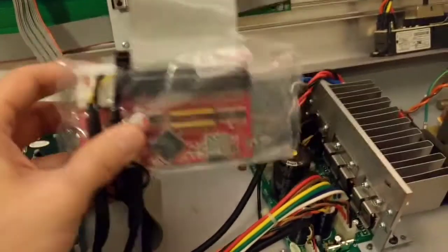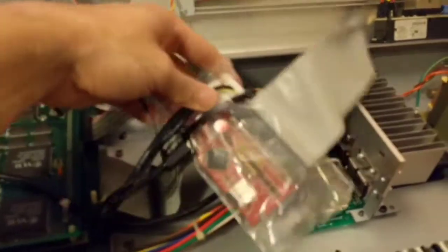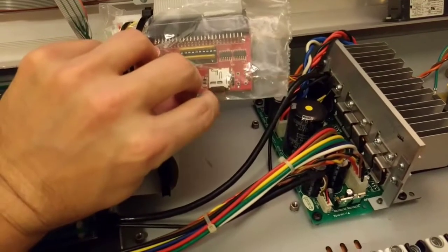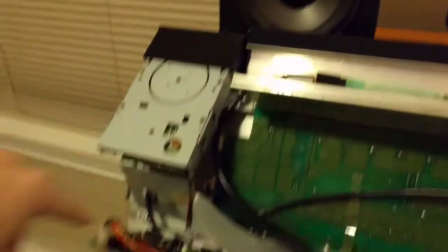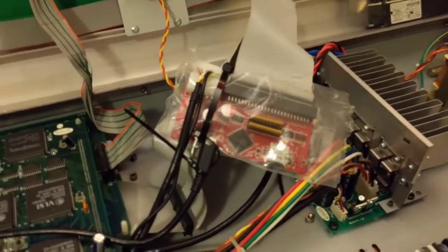It's got your Molex power supply. I purposely put a plastic bag around it just to make sure it doesn't touch anything else — it is loose in here. Some people strap it down or put a screw in somewhere. I'm not that fancy. So what I'm going to do is cut a little hole here in the plastic bag and take that ribbon cable and plug it in here. Then I'm going to try and decide whether I want it to come out here at the back, or maybe through the floppy drive port, or just right here so it doesn't interfere with the floppy drive. I'll find the cable, cut the hole, and we'll see if it works.